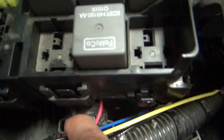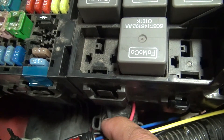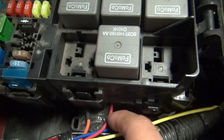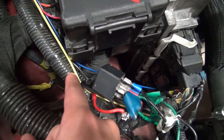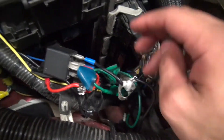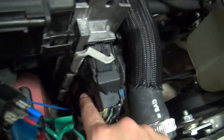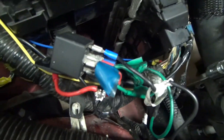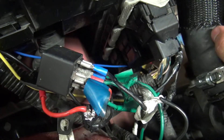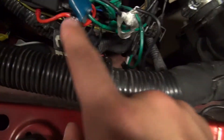This is the coil — it goes to the coils and that's what interrupts the spark plugs and lets you control RPM. The yellow wire is going to be your RPM signal wire. It goes to the Wattbox and connects to the middle connector on your PCM at pin 1, where you splice in and solder. When programming, you're going to select fuel injector other for the RPM signal source.